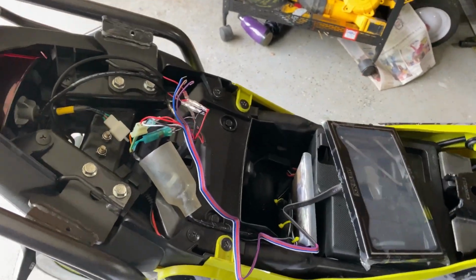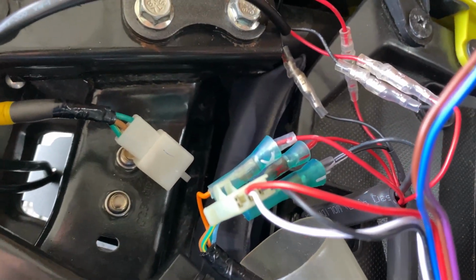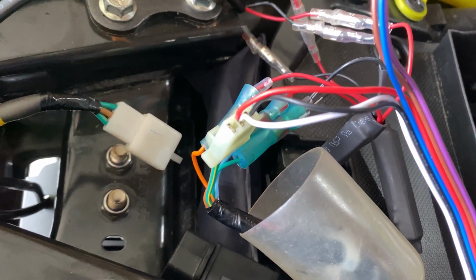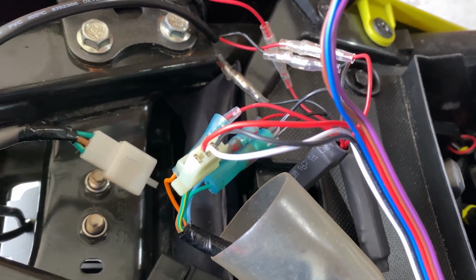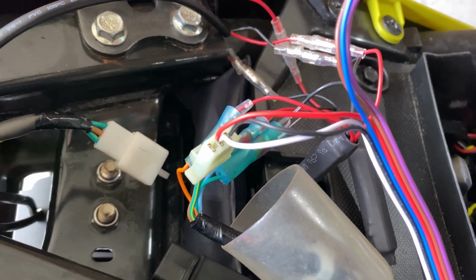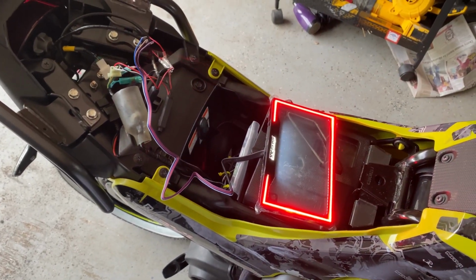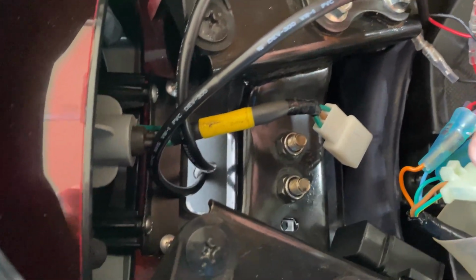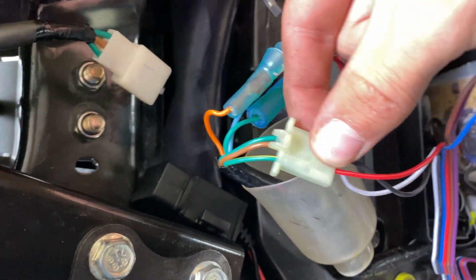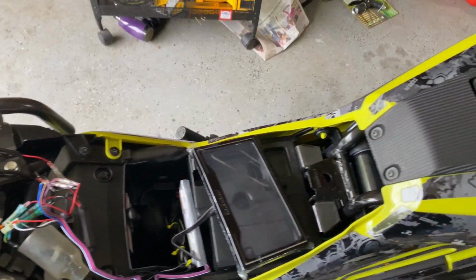All right, we're off to a great start. So essentially, unplug that, and what I did was connect these wires into this plug. The white's gonna be positive, and the red is going to be your brake wire, and the black is the ground. And as soon as you turn the key on, we get it to turn on. So that means at least one thing, that the black circuit is just that plain green wire. So the green wire is the ground.